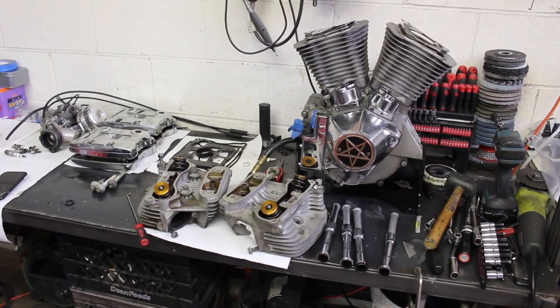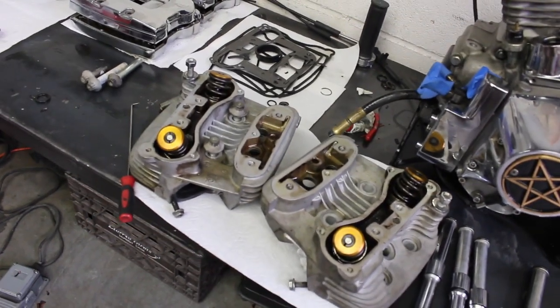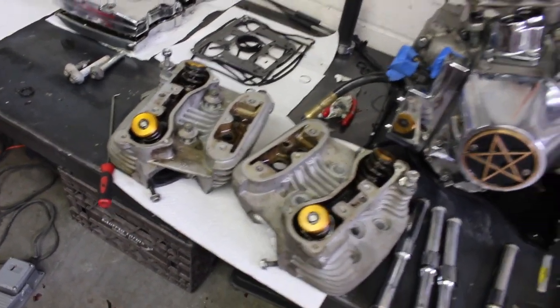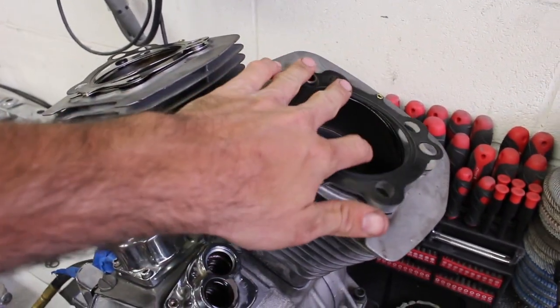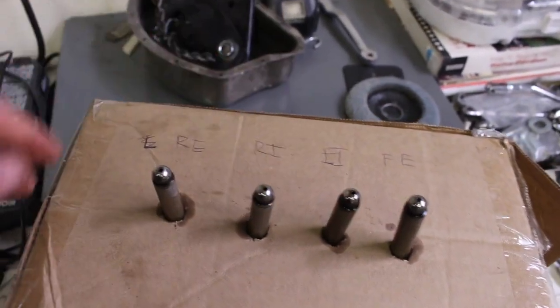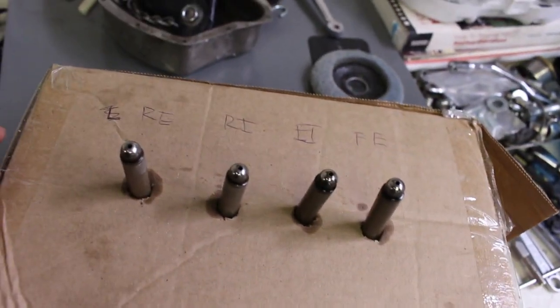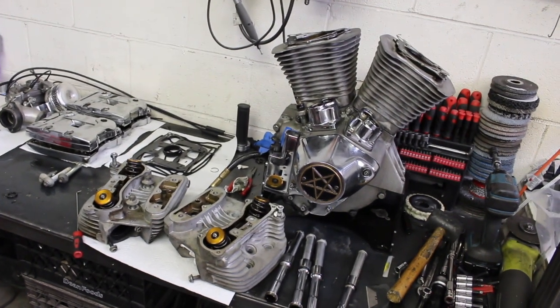I had to go run around real quick but I just made it back, so we're going to get this buttoned up. I got the heads pretty cleaned off right now — I'm going to give them one more check through before I put them back on. Here's the new gaskets we're running: triple-ply metals, all stainless — those are nice. And another thing, this is how I usually do the push rod tubes. An old guy I used to work with showed me — always have a labeled box so you don't get anything mixed up and they all stay together instead of just throwing them on a rag.